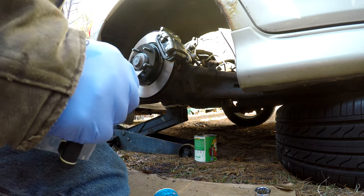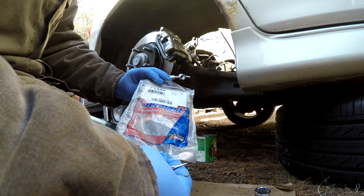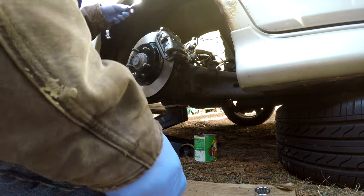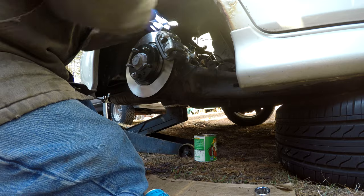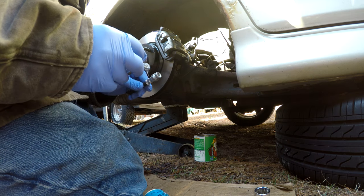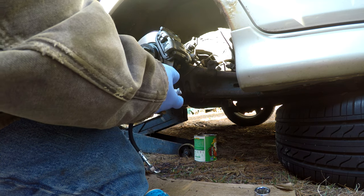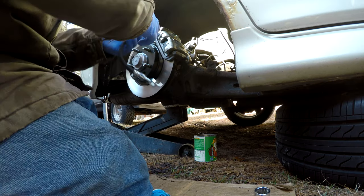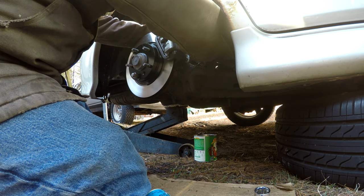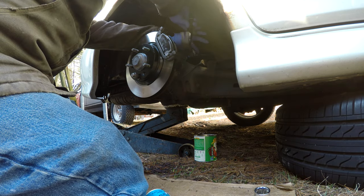We're gonna work on putting the hydraulic brake hose back on. It's a Duralast part number 71446, and I got it from AutoZone. I think they were, I don't know, 15, 20 bucks a piece. They're universal, so one hose, one part number fits both sides. There is a little bit of a key to the hose, so it doesn't just fit right in the bracket. I do put a little never seize on it, just because it makes it easier to come out later on. And you know, we're up in the Rust Belt here, up in Massachusetts, Rhode Island area, so things corrode pretty quickly. So now I'm putting it back in the bracket there, and we'll get it on and put the clip in, and then tighten up the metal brake line to the rubber hose assembly.